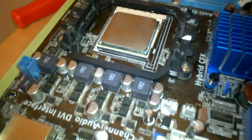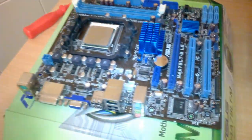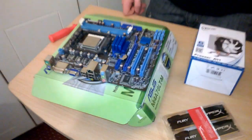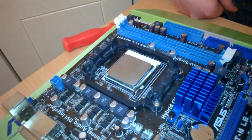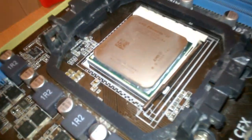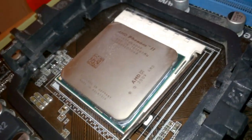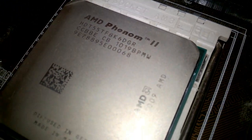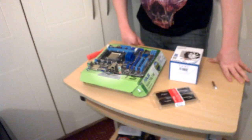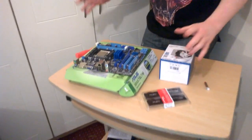This is a Micro ATX motherboard going into a full tower, so if it looks a little weird that's why, but it'll perform perfectly fine. Here's our AMD Phenom X6 1055T - true six core, which means there are actually six cores, not three cores and three logical. It's clocked at 2.8 GHz and the turbo clock is 3.3 GHz if I'm not mistaken.